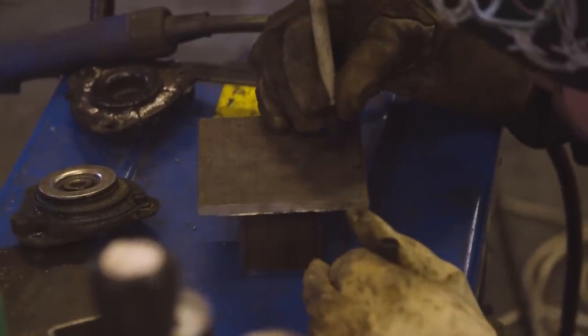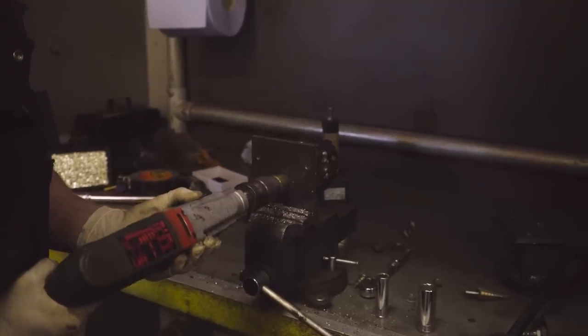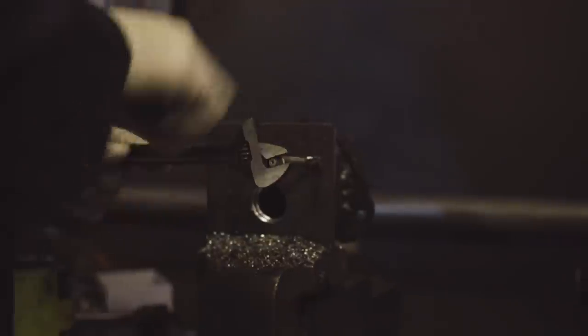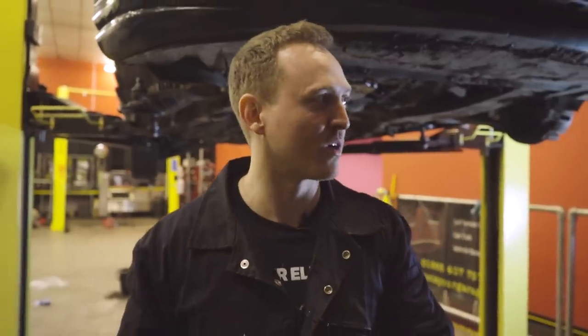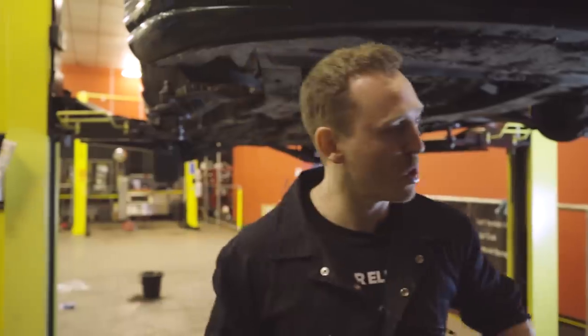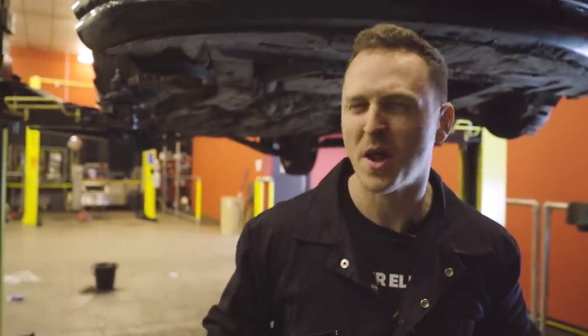The sole focus is now finishing the front. Adam marks, punches, and drills pilot holes before handing them to me to widen the centre with a step drill. This gives us enough access to later drop the nut back onto the top mount when we reattach it to the spring and damper unit. Once that's done, Gareth taps the three surrounding holes on each plate to allow new bolts to come in through the top of the suspension turret. It's just all coming together — it is currently 20 past six, which means we have 40 minutes left to assemble everything and look at our glorious creation.